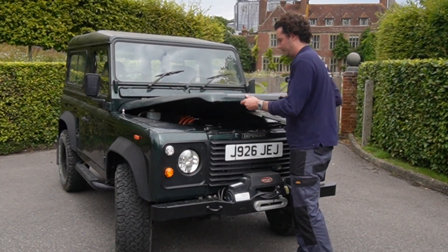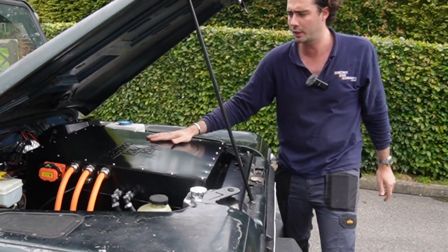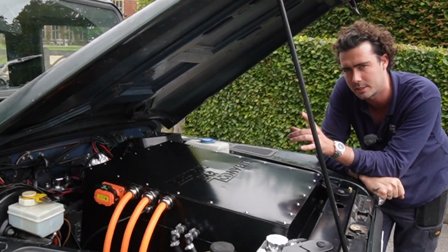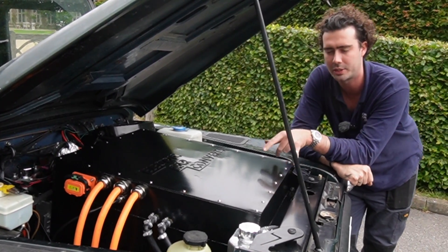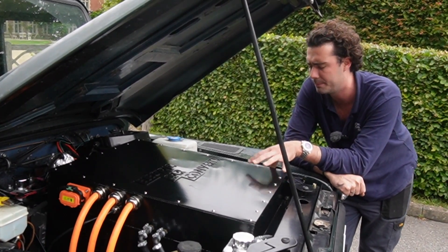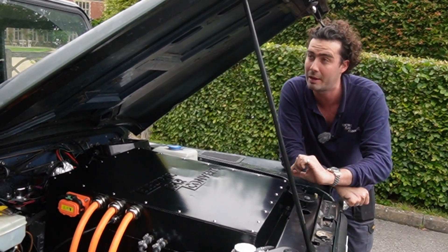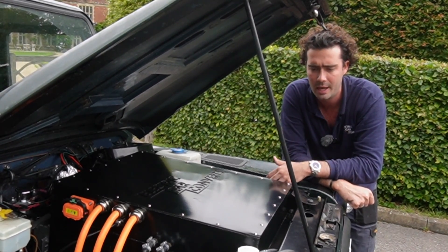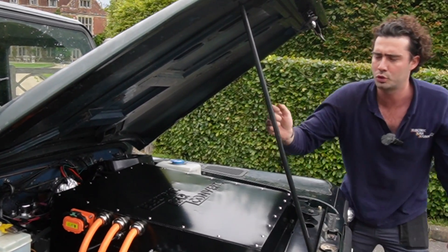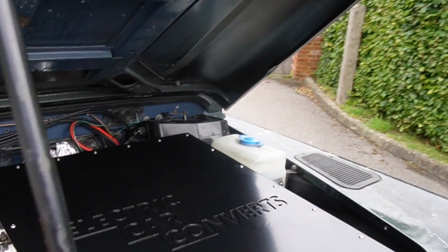Let's have a look at what we've done. Really nice looking battery box there — that has got seven Tesla Model S batteries in it, but not any old Tesla Model S batteries. They're actually the 6.4kW option, which they basically only put in the big Model Xs and the big Model Ss, like the P100Ds for example. So that means we've got 44kW in here, all under the bonnet with a Hyper9 beneath them. It was very close in the clearances, but we managed to get it in. That's good for around 110 to 120 miles of range, and then you can just plug it in at any charge point — whether that be at home on your three-pin socket or a pod point.